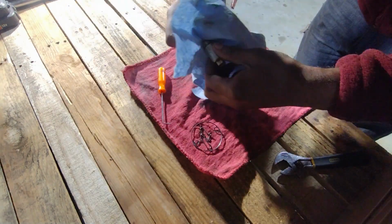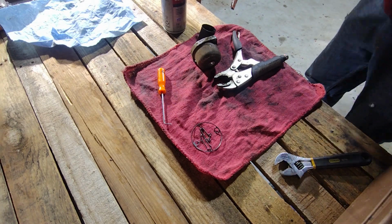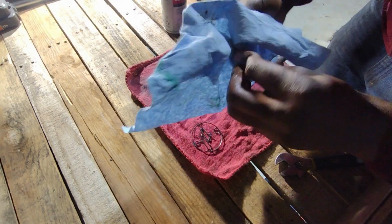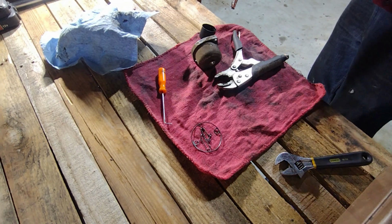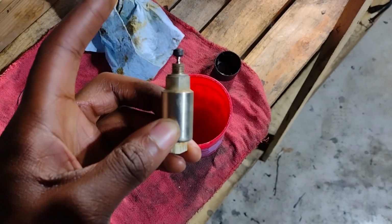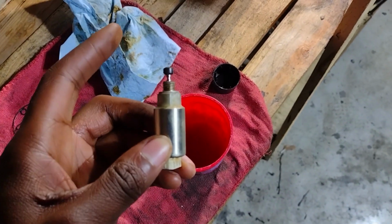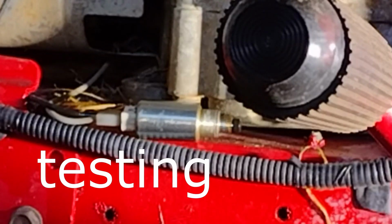What I will point out is that the actuator for the backfire preventer was completely seized from rust and varnish. I got it free and operational by working it back and forth while swishing it around in gasoline. After cleaning out the bowl, I reinstalled it with the old gaskets. Obviously, the carb leaked everywhere. As a matter of fact, it leaked so bad I didn't even attempt to run it and just ordered a rebuild kit. This was the best course of action since the carb also needed a very thorough cleaning.